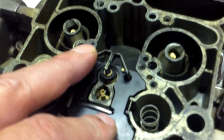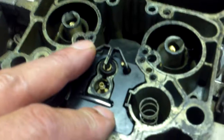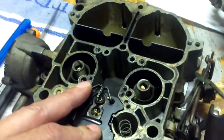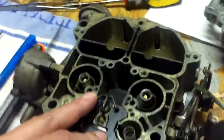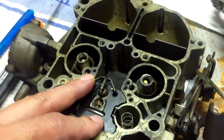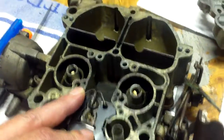You've also got to do the same with the power piston. That's the spring right here, and here's the power piston. You have to do it very delicately and carefully, because if this comes up and you press down on it or damage it while you're trying to reassemble it and you bend those rods, they're not fixable. You have to replace them, and it can be a challenge to find primary metering rods for a specific Rochester Quadrajet because Rochester made so many of them and each pair is unique to the carburetor it came with. So do your very level best to not damage it while you're working on it.